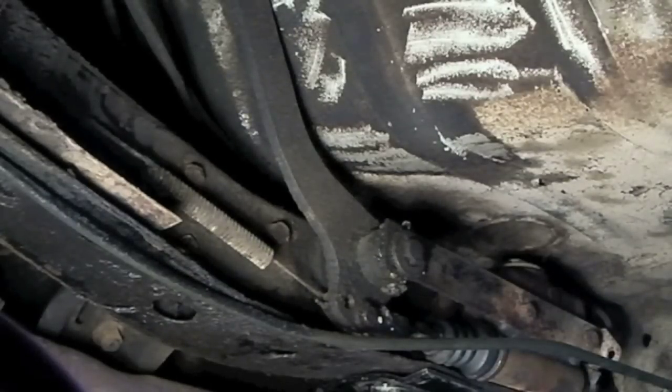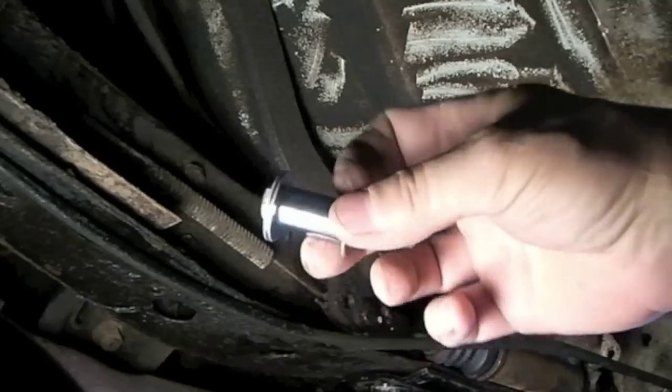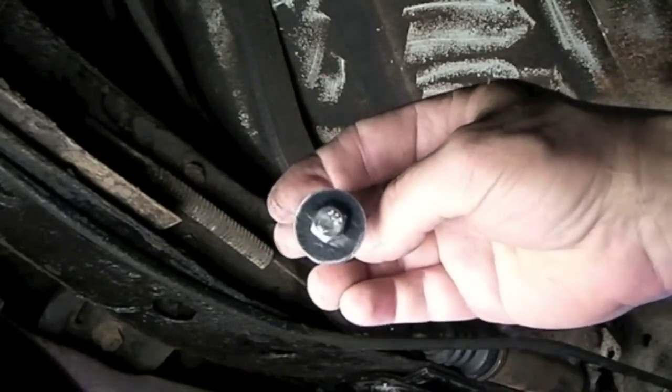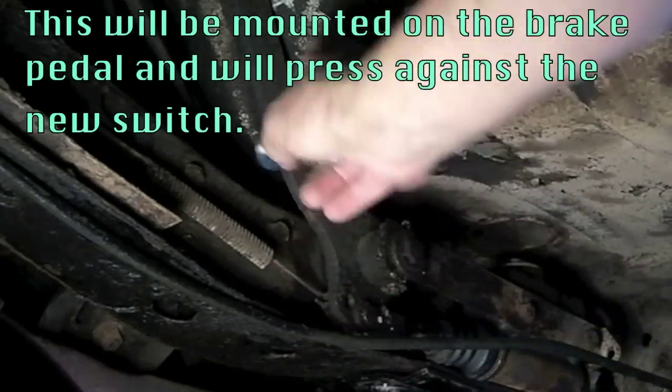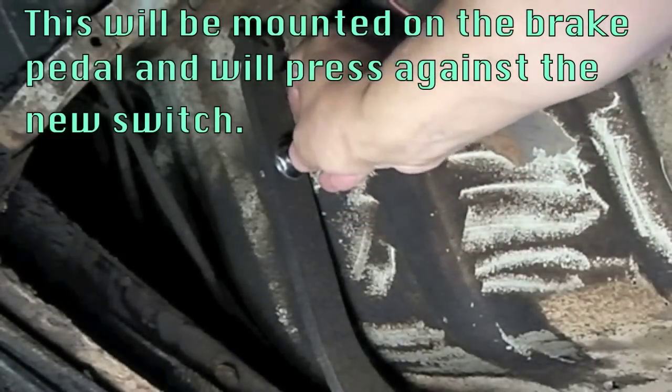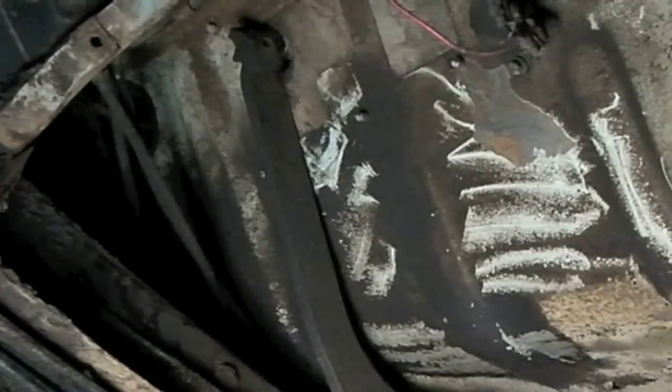The switch isn't going to just do it by itself. I've got this — a stainless steel bolt with some stainless steel washers. I'm going to drill a hole in this, put it in place, and then it'll rub against this to actuate the brake lights.